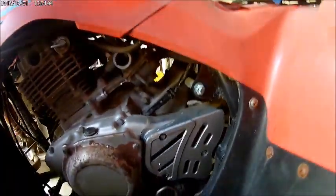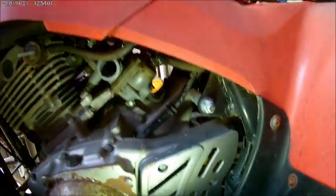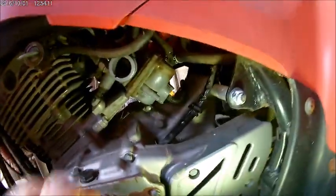Friends, this is where the fun begins. I got that other side off of there. Loosen up on that clamp some more and just, you know, wiggle it out of there. So there's a couple things that come off, and here's where you just gotta trust the process. You unscrew this throttle cable, I believe it is, or choke cable, I think, and then it comes out. This is the throttle plate. Unscrew it. Kind of scary what comes out with it, but let's see, you can see what I'm doing here.